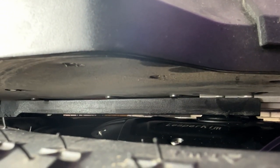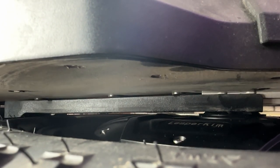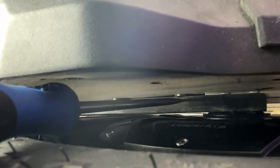When dropping your battery pack into place, you can remove the cover with its two screws, but if you keep your battery cables taut there's no risk of pinching. When putting the battery pack onto the suspension, the black plastic trough can get stuck on the channels of the battery pack right where the circular washer spacer-looking things are. There are three O-ring-looking things on the battery pack when viewed from the side. Use a long screwdriver to push that plastic trough into the channel — you may have to do this on both sides.